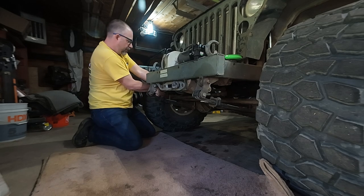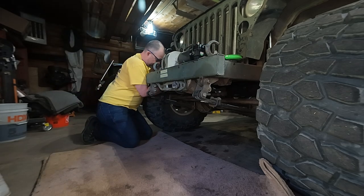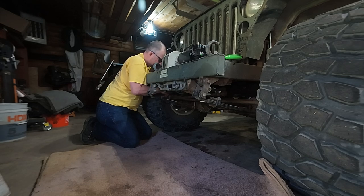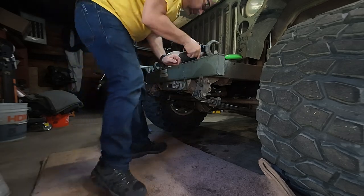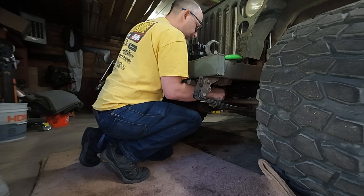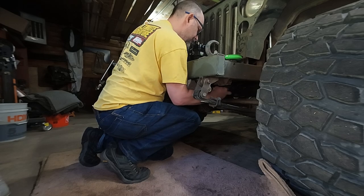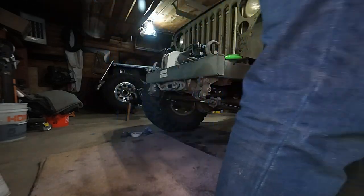It just ended up having a very large gap between third and fourth gear, and so if you couldn't pull it in fourth gear, which living at elevation in Colorado is a decent amount of things, even just the kind of roly-poly type stuff, it was like totally wrapped out in third gear, even with the 430 gears. And so I just didn't like that combination really. And so I ended up changing it to 538s.